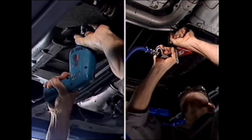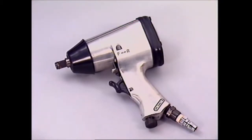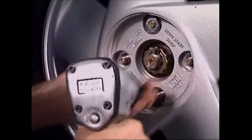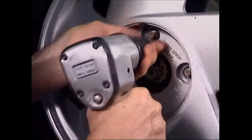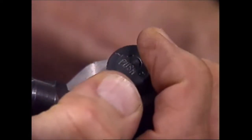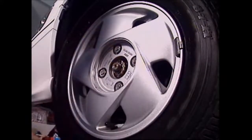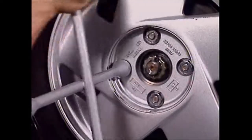And an air drill also doesn't get hot with heavy use. The most common pneumatic tool in an automotive workshop is the air impact wrench, sometimes called a rattle gun. Taking the wheels off a car to replace the tyres is a typical application. It often needs a lot of torque to twist the nuts free. The rattle gun can be set to spin in either direction, and a valve controls how much torque it applies. It should never be used for finely tightening wheel nuts — there's a real danger of doing them up much too tight, which could cause the bolts to fail and the wheel to shear off the vehicle while it's moving.